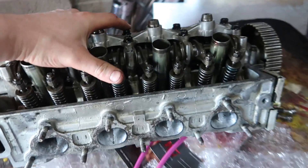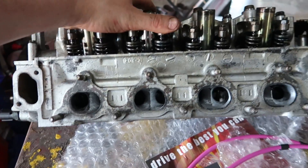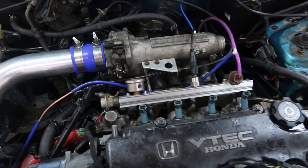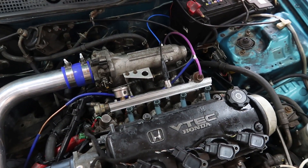Here is the head, it's all freshly decked, nice and clean, ready to go. I've just given it a little port to see if it makes any difference to spool times and stuff like that. I've ported the inlet and the exhaust side, and I've got logs before and after. I've fitted some RX-8 550 injectors instead of the K20 ones, just for a little bit better atomisation. These ones atomise so much better than the decapped K20 ones.